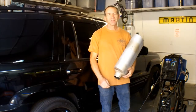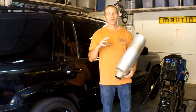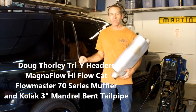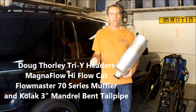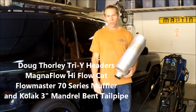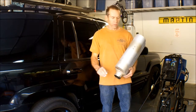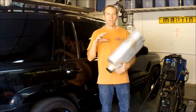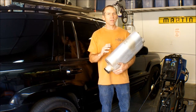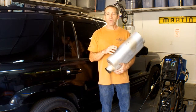Hi, Martin here. Today is more like a fun project. If you saw my previous video where I installed a full-length exhaust on the 04 Jeep Grand Cherokee with a 4.7, I did headers, a Delta 70 series muffler, a high-flow cat, and 3-inch exhaust all the way out. And I used V-band clamps to put the whole system in. I said I'd do that in case I ever wanted to change mufflers.